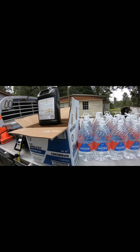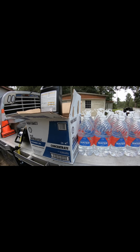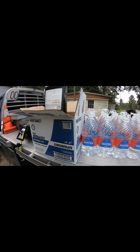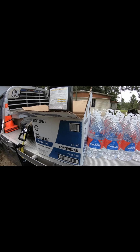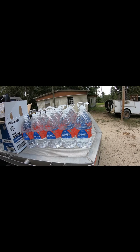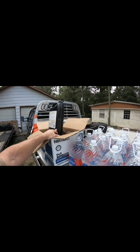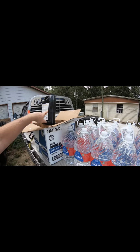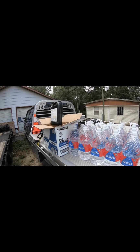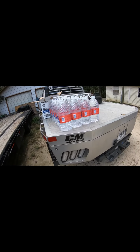And then I'll put the 4 gallons of the concentrated ELC in there, and top it off with distilled water. The system holds 8 gallons, so 4 gallons of concentrate, a little bit of water that's left in the system, plus topping it off with this. And my plan is to take 2 of these jugs and mix them up 50-50 with the one extra gallon that I bought. So I keep that in the truck. If I need to top it off, I've got the exact right stuff that I'm looking for. But this job's all done.